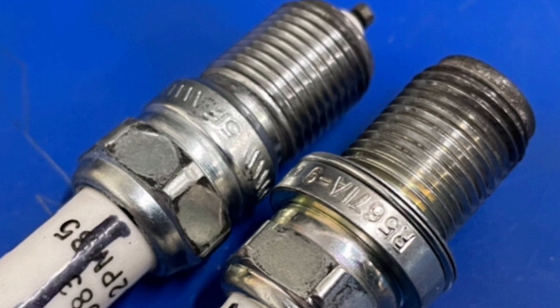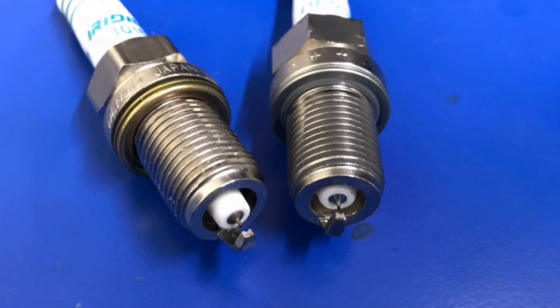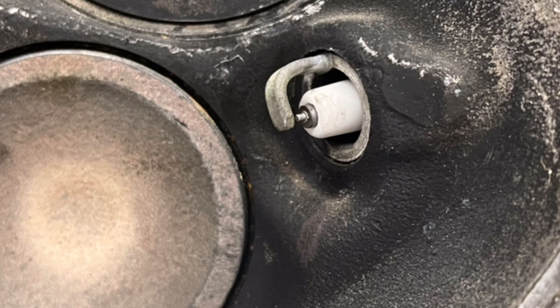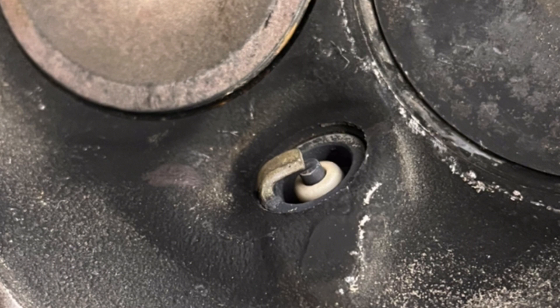One plug is gasketed and the other is a tapered seat plug. I run this test because I often interchange these two, especially on the LS heads. A lot of times we have access to gasketed plugs in different heat ranges for turbo, supercharged, and nitrous applications, and they don't always have those in tapered seats. So we just replace the tapered seat plug with a gasketed plug. But I always wanted to know — is there a difference? There are two things to consider: the tapered seat plug protrudes farther into the chamber. Does it change static compression by displacing space? Does it help with flame travel and put the spark action more toward the center of the chamber? As opposed to the gasketed plug, which puts the end of the plug closer to flush with the chamber. I'll show you a photo. We did the test anyway because I wanted to find out if there was any difference.